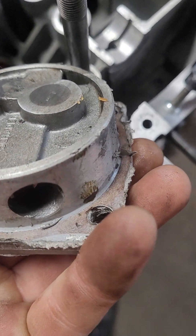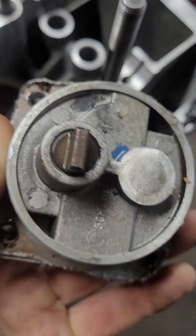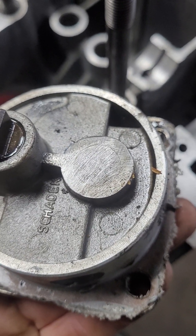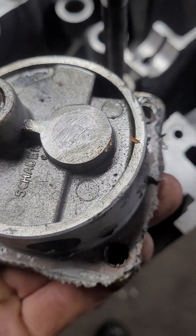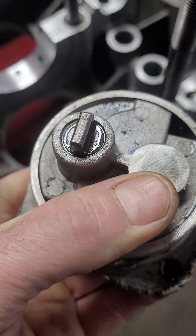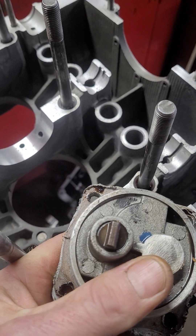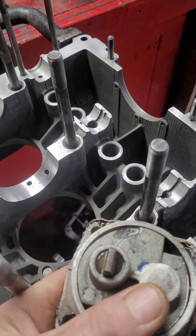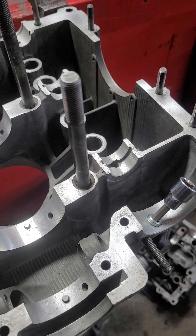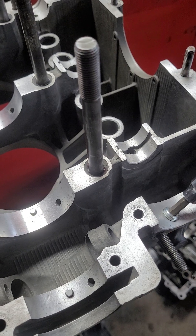You can see on this one here I've actually filed off the back of the pump's solid stud — the shaft that one gear rotates on — and made sure that when it's in the case, the camshaft bolts that hold the cam gear don't touch the back of the pump. I've seen this happen: a guy bought an aftermarket pump, bolted it in one afternoon, and because he put a bigger pump in it the back of the pump was closer. It just milled off the back of the pump and literally filled the engine with liquid aluminum — it filed everything down and went all through the engine. Even if you put an aftermarket pump in with the engine together, you can do measurements to ensure your cam bolts are not going to be running into the back of that new pump.